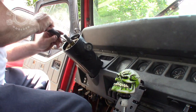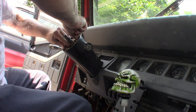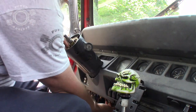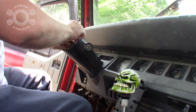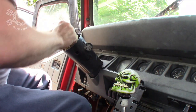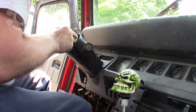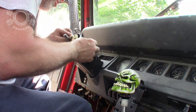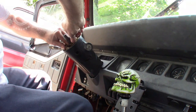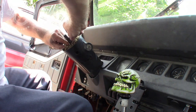There's one right there. Then see how lucky we get pulling this switch out, because oftentimes that wire is running down through the column right here. You may have to get underneath here and push that wire up this way some while pulling this to get that out of there. But the major trick is if you can get to what's holding that, you ain't got to worry about all that fun stuff.